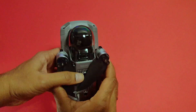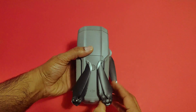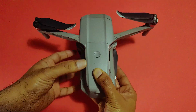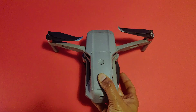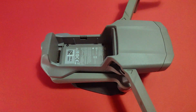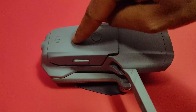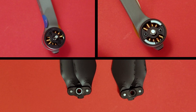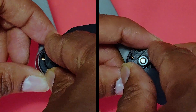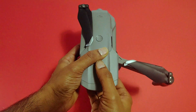To unfold the arms: the front or top arms open outward, and the rear or bottom arms are pushed down and then pushed outside, as shown in this video. To remove the battery, press the buttons on the side of the battery and pull. To insert the battery, just push until you hear a click sound. The propellers have two color codes — plain black and silver or gray — attach the gray-marked propeller to the motor with a gray ring and the black one to the black motor.